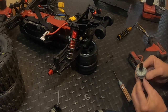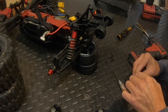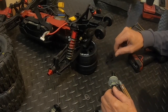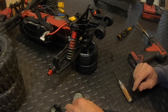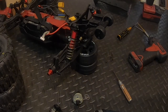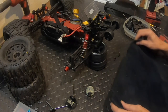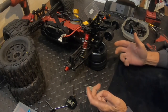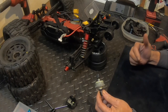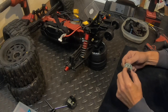I'm going to look for some shims - hopefully I have enough to shim this thing tighter. After spending the last couple of hours looking for shims and getting my diff case out, since I just did the diff on the EXB, I don't have any shims. So I think what I'm going to do is try changing out this bearing. I'm also going to see if maybe I can double up on the gasket to make it tighter, since I do have a gasket, but I need it tighter the other way.